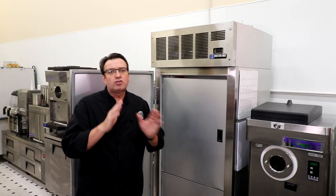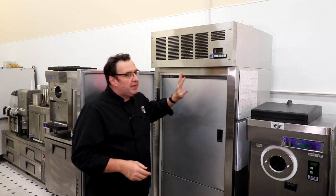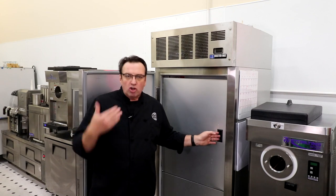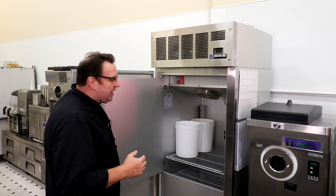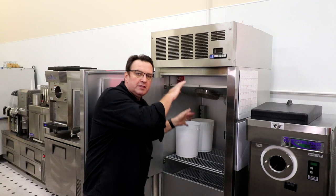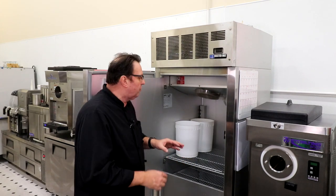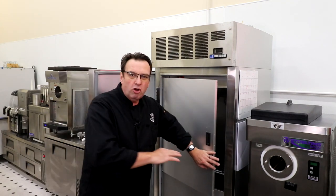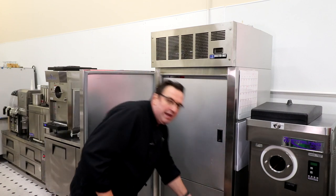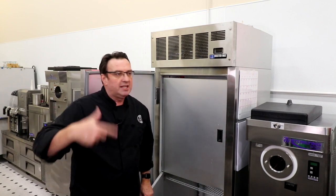The difference between your static freezer and this blast freezer is, for the most part, you've got two internal doors — that's extremely important. If you see the term 'hardening cabinet,' they're primarily the same thing but have two internal doors. This basically stops the cold air from escaping. If you want to get in here and take one of your buckets out, you're not pulling the whole door open. You can open the bottom door and pull your ice cream, novelties, cakes, pies, pints, or quarts out without upsetting what's on top.